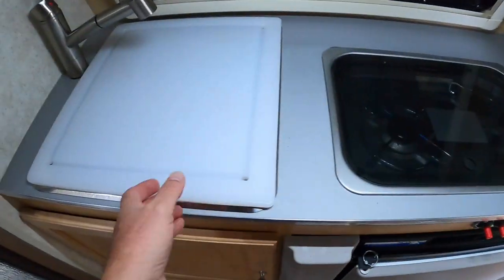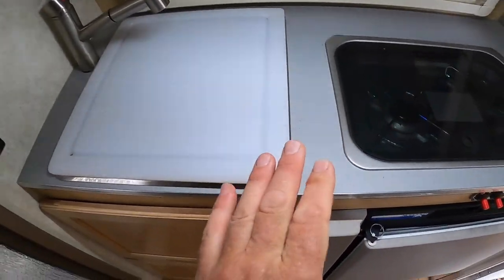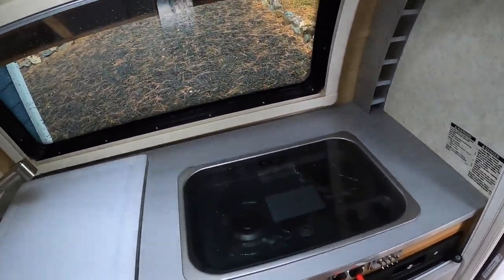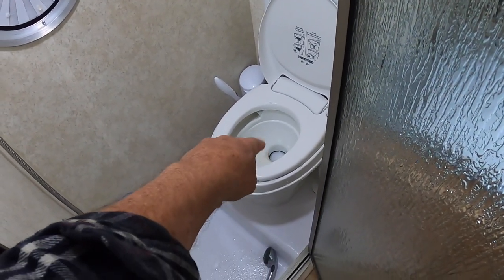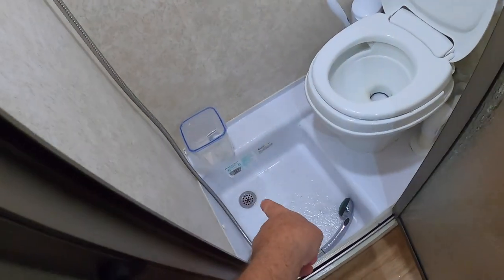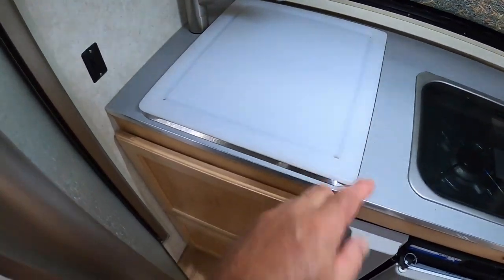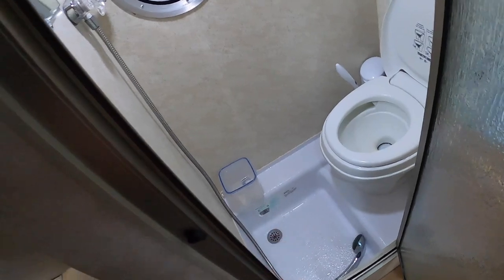Not many dark places. My sink and kitchen area has been completely scrubbed down with water and bleach so there's no smell of any food at all. Mice don't like it. My spices are out, my cabinets are empty. The only antifreeze I use is just a little bit in the toilet to keep that seal good and keep it from freezing, a little bit in the shower trap, and a little in the sink trap — just enough to keep those areas from freezing. Everything else has been blown out.